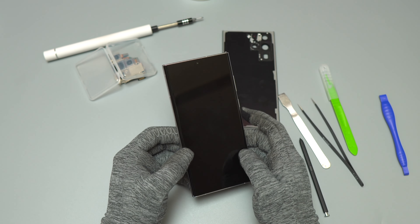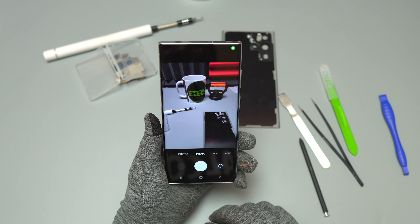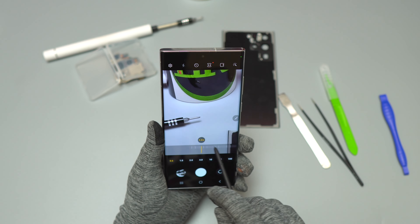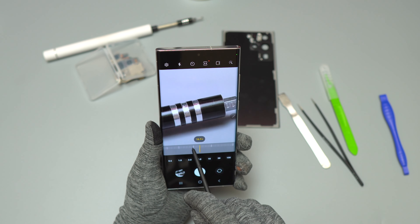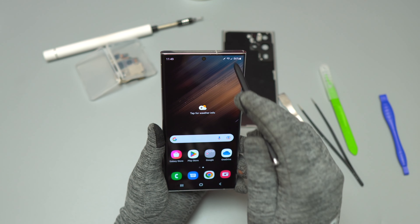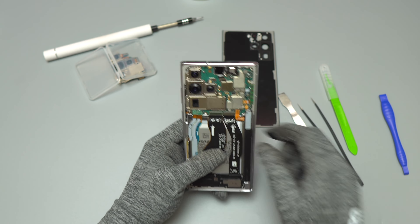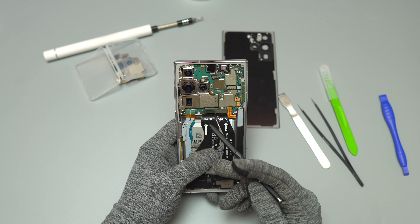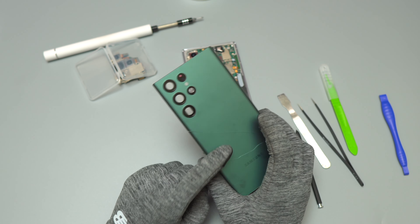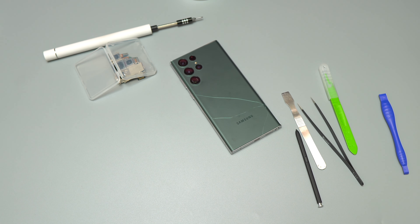After all those resets, I turned on the device and tested the cameras, but it still did not work. The main camera app was not working, and third-party camera apps I installed were not working either. I was confused — I had done everything on the internet for compatibility issues. At that point I had two choices: purchase another camera, or check my connections on the motherboard. I checked all the connections on the motherboard, tested the cameras, and everything worked miraculously. In reality, I never had a compatibility issue — but a bad connection issue.